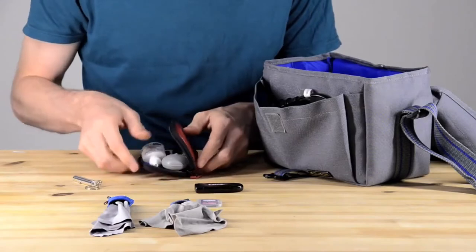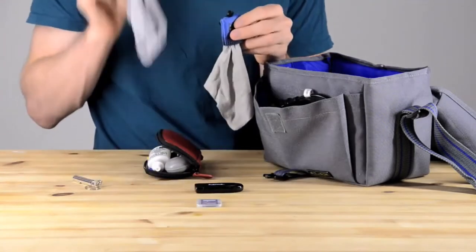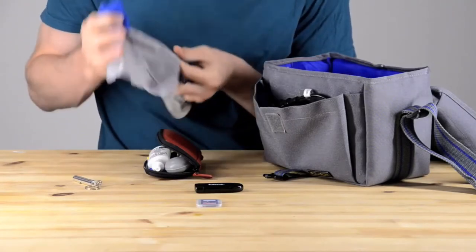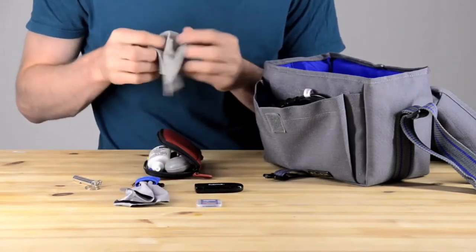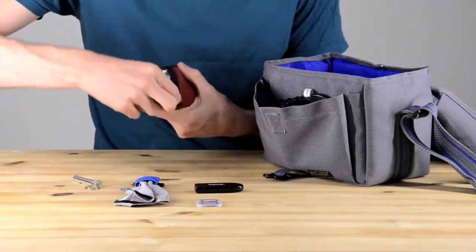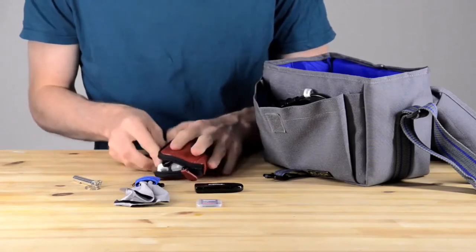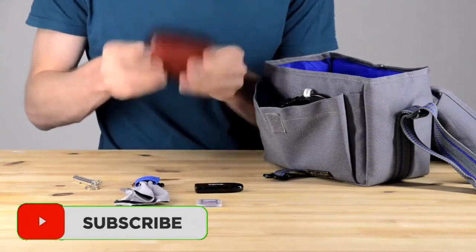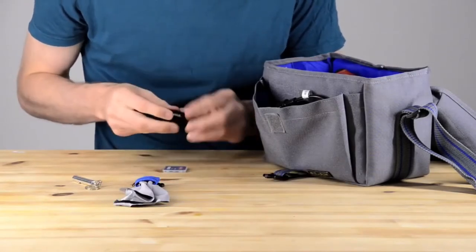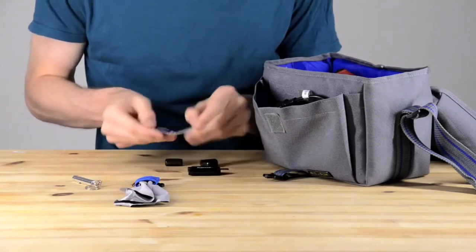There's a second brush which is sort of the body brush — if you've seen the cleaning sections of this lesson, you'll know what that's for. I've got two different cleaning rags: the one I'm holding right now is an old used lens cleaning cloth that we now use only for cleaning the body of the camera — it never touches optical glass anymore. The other one, sitting in front, is for cleaning lenses. I try to keep those two things separate, because anything inside that cleaning cloth can scratch your lens.